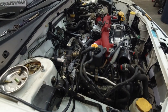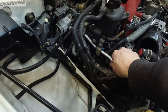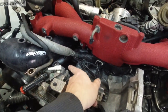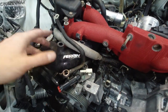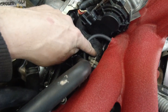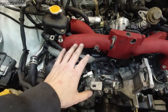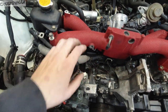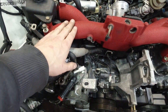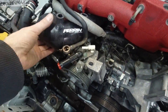Okay, another update. This is much better here after putting that bracket in. Like a dumbass again, I ran this harness underneath the turbo inlet pipe — it should be over. So I had to take the pipe out, disconnect it right here, disconnect the blow-off valve. Then it's actually fairly easy to pull this out. You don't need to take the intake manifold off to install these. You do have to take these off if you take the stock one off and on, but not for the aftermarket ones because it's so flexible.